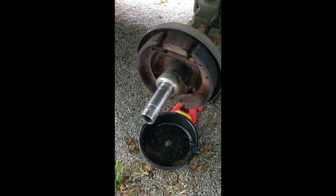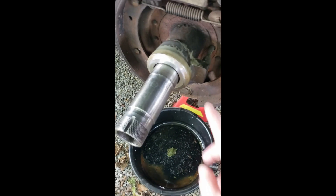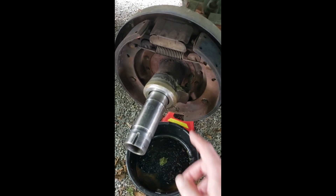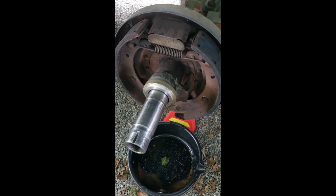Am General designed this special air sleeve — which I am still kind of cleaning up — to go on the existing spindle. It looks like it is actually glued on; this looks like adhesive here. It goes over to where the air comes in, so this thing is actually glued onto the axle. I heard that if you apply some heat, you burn off the epoxy and it just slides off, but I'm going to leave it as is for now.